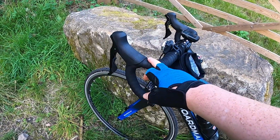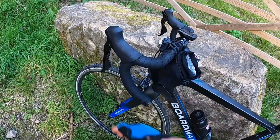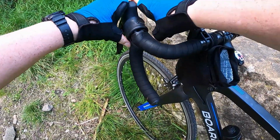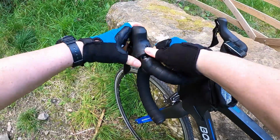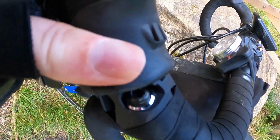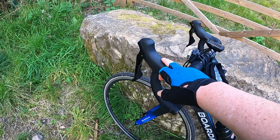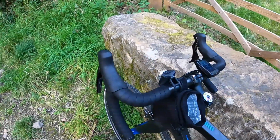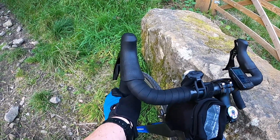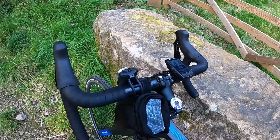Again, when you get a bike out of the bike shop, these hoods will have been put on just vaguely, you know, on the bars, roughly in the right position. But do feel free, if you just lift up the plastic protector things or the leather protector things, you'll see a way to loosen them, and then you can bring them higher up the bar, you can bring them lower up the bar, and you can also, at the stem, change the position of the bar as well. So I think that needs a little bit of attention as well, depending on where on the bar you like to have your hoods. Some people, if you're on the drops quite a lot, if that's your preferred way of riding, you might want the hoods a little bit further down, or you might want to rotate your bar down a little bit.